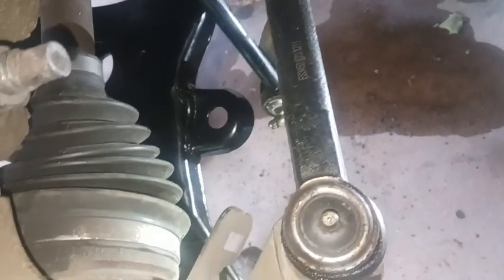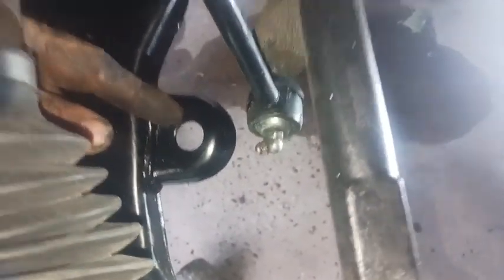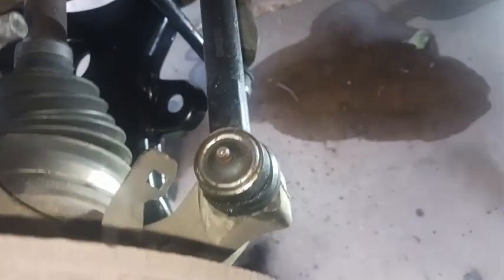But I know it said it fit for an 06 Grand Prix base model, so I know those are the other style. I've had control arms before that didn't have those little ears on them at all, and that was the one that these sway bar links came with. And then whenever I pulled these off the black 06 Grand Prix, I upgraded to this style with these tabs, and changed the sway bar to where it comes out and over to here. And then it just had a little straight bar, just like how it's set up on the 07. Just like this. And this was the style that I switched to.